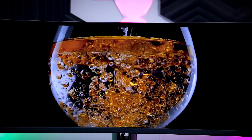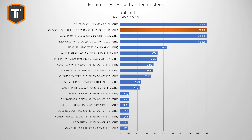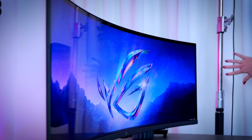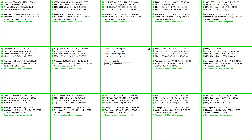Since this is an OLED panel that turns pixels off when displaying black, the contrast is perfect, especially so in darker rooms. It does have an anti-reflective coating so it's not as glossy as traditional OLEDs, but in very bright rooms it might end up looking a bit more grayish. I still think it's an improvement over the 34-inch QD OLED models where the grayness was much more noticeable. The uniformity of the panel is great, as you'd expect from a self-lit OLED — the center is a tiny bit brighter than the corners but it's consistent all around and you'll never notice those differences subjectively.